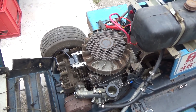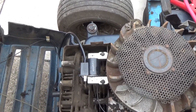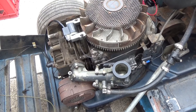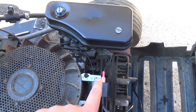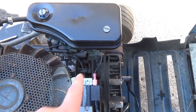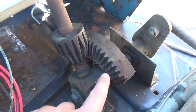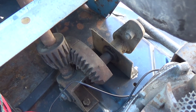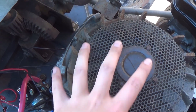I wasn't planning on this, but I had to remove the shroud because we were getting intermittent spark — we had it, lost it, then had it again. I decided to replace it with a new Amazon coil, and that solved the problem. I snipped off the wire at the bottom of the old coil, so I'll still need to run a kill wire. Make sure the wire isn't too long so it doesn't spool up and get caught in the flywheel or pinched. I've routed it down underneath the carburetor and along the back.